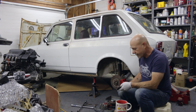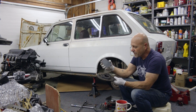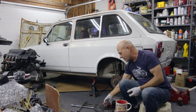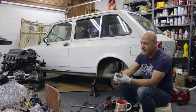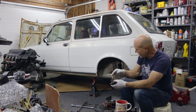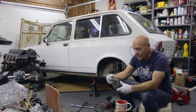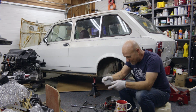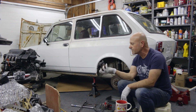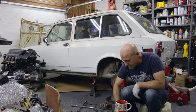All I really need to do is use this bolt pattern and some 7/16 inch thick cold rolled steel to make caliper adapters using the bolt pattern that bolts the calipers on. I did all the measurements and it'll just bolt up almost perfectly, so stay tuned for some very slow band sawing with the Milwaukee Porta-Band. I've got the Fiat 500 spindles which are completely useless to me now, but maybe someone else could use them.